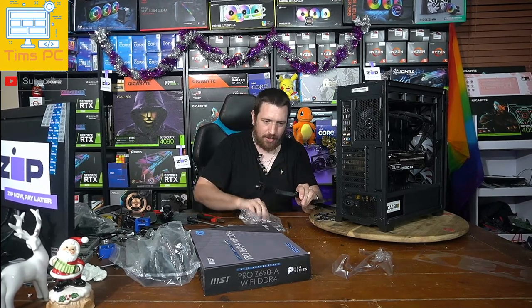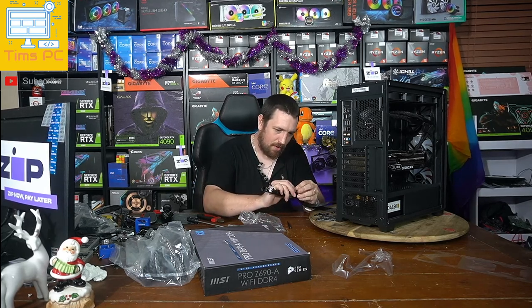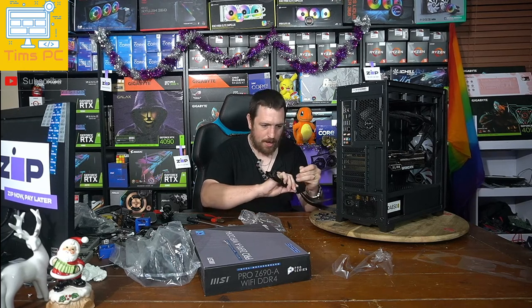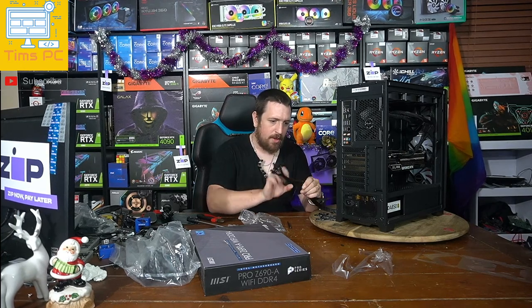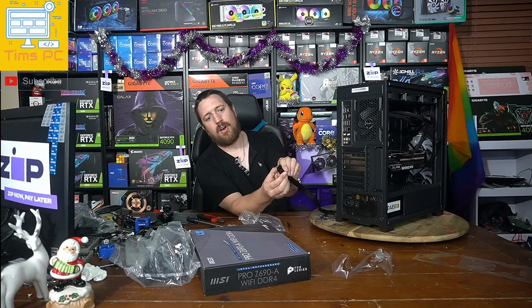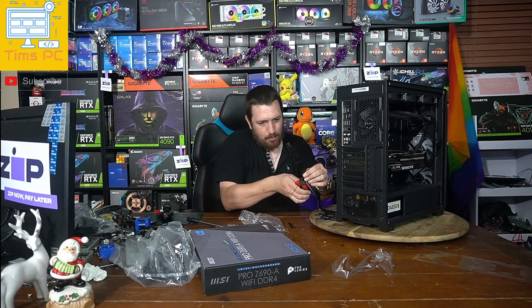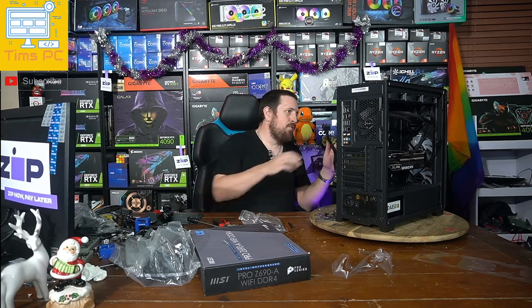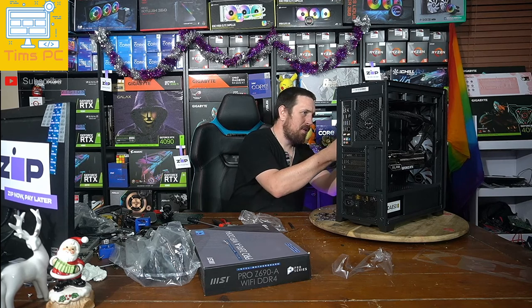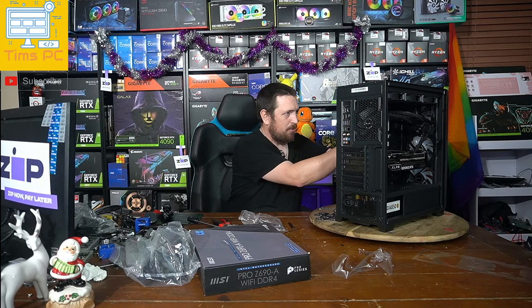And then use another cable tie to tie down any excess plugs that you have from your cables. So you want to be creating with cable ties a cable that looks roughly like this, with your three 8-pins nice and in line like that. I found that this is the best way to do it. I've done a few of them, so I've been able to experiment.